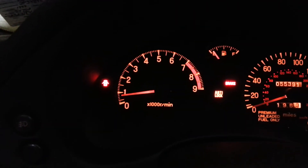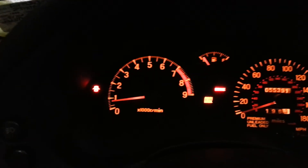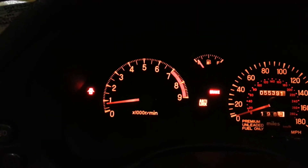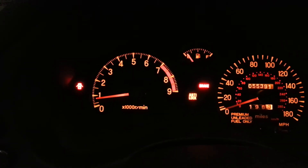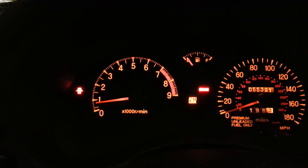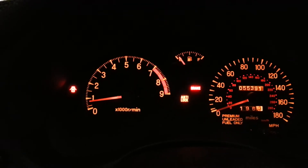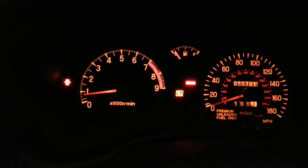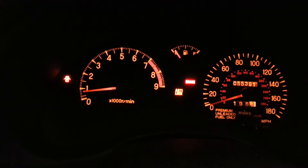At 750-800 rpm — that's what you're shooting for. What I'll do next is take the gauge out, hook the solenoid back up, and then we'll compare it against what the gauge on the dash says. He'll know what his mins and maxes are with this gauge without having to swap it out. I'm going to pause it now, put in the new solenoid, then we'll look at the gauge at both normal operating temperature and at cold idle start.